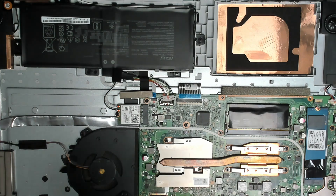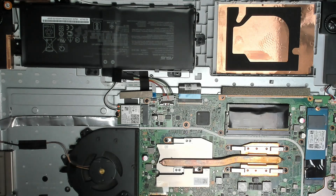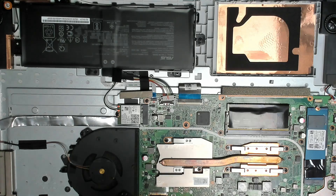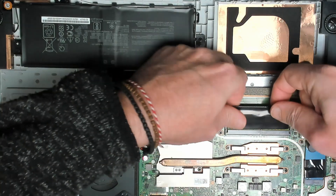Since all voltages seem correct, the battery charges, the EC chip reads the power button, and all coil voltages are okay, the next thing to check before looking at a potentially corrupted BIOS from a Windows update is the RAM. This motherboard comes with built-in 4GB, which is on the other side of the board, so let's remove the RAM stick.